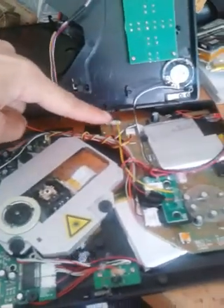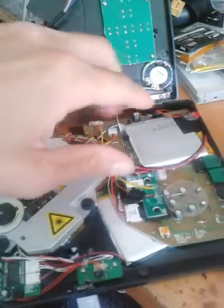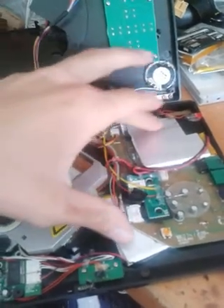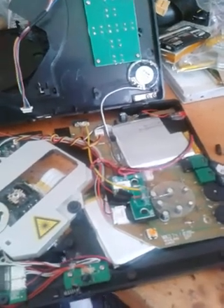Basically I just wired that to the plug on the back here, wired that to the board, and then wired the three terminals for the battery — plus, minus, and middle — to the two cells here, because it's a 7.4 volt nominal voltage.